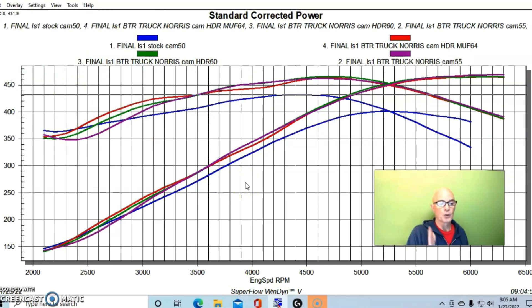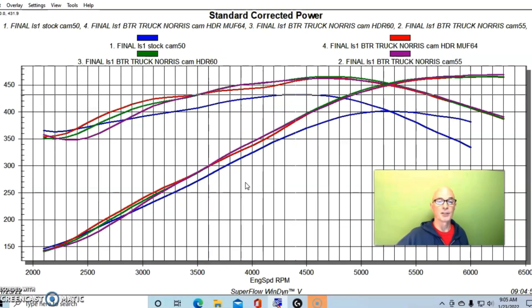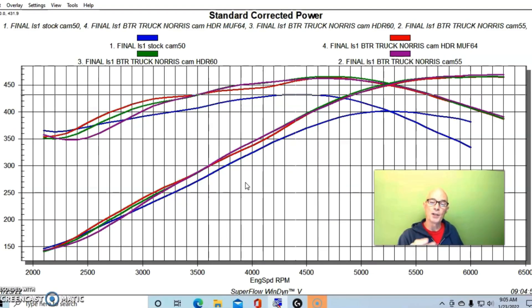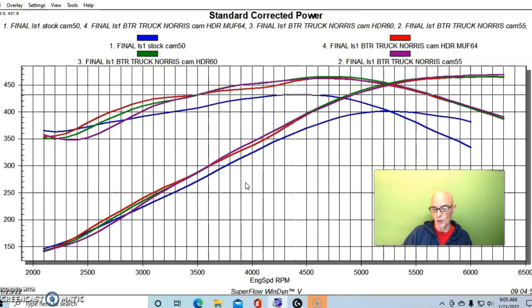Here's what happened when we changed the collector extension length with the mufflers — shown in red. We shifted the crossover point even lower in the RPM range, down around 2300 to 2400 RPM — another 150 RPM shift. We gained a lot of torque compared to the 1-7/8 headers, especially compared to the 1-7/8 with the short collector extension. We did see a slight drop in torque from 3600 to 4400 RPM, but after that basically no change. What you're seeing there is a change in scavenging effect from the collector length — it's not a flow problem, because that's even before the torque peak and way before the horsepower peak.